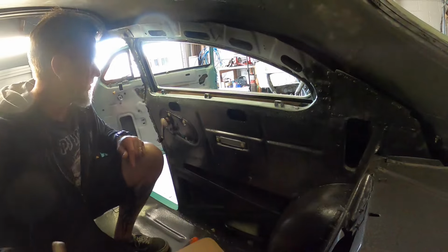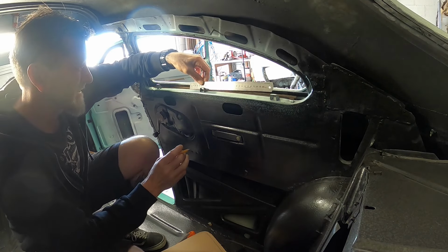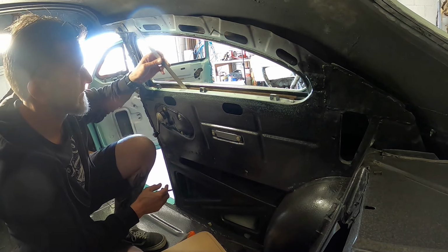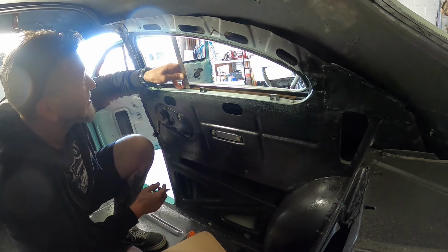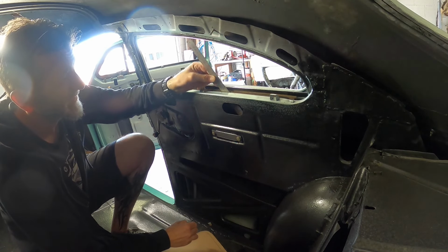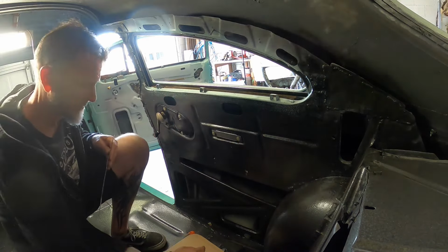So what I'm gonna do now is come along here every 200 millimeters, which is roughly 8 inches. And I'm going to take that same measurement, so on number 2 and number 3. So look, oh, here we go, metric. So at number two, we should be, well, yeah, kind of vertical, 210. And number three, I'll get this in there now. Vertical into the track, you go 160 plus 10, so that'll be 170. And that was every 200 spaces.